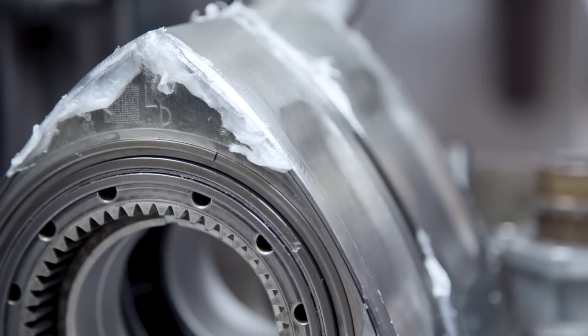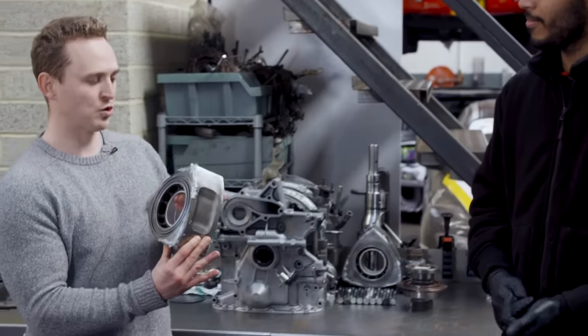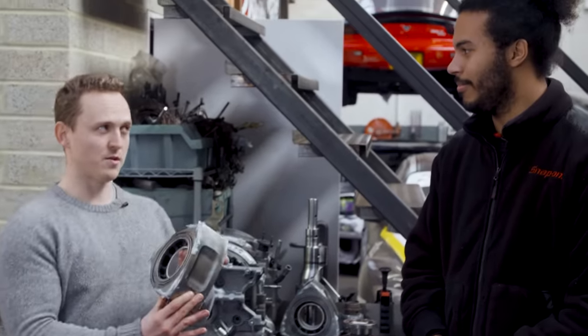One of these rotors is actually original from the car — that's the one you're holding right there. We've cleaned off all the carbon in all the seal channels on the rotor faces and replaced the bearing. Then we put new o-rings in the oil control rings, as well as new springs underneath them. We put new side seals and new corner seals in. We clearanced the side seals to anything tighter than 0.4 of a mil. The apex seals will be going in when we put the engine together.